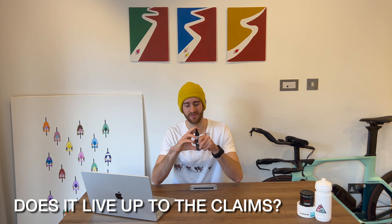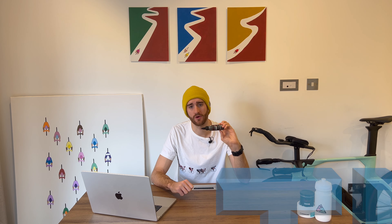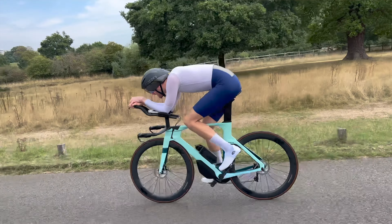With my experience, this chain lube really does live up to its marketing claims, which I think is quite rare for a lubricant. So who is this chain lubricant for? Most people, really. It's a fairly low-maintenance lube with long durations between maintenance intervals and helps your components last longer. I wouldn't recommend it for mountain biking in dry conditions — because it's a wet lubricant it will still pick up lots of dust — or for time trialists trying to squeeze every last watt of efficiency, who might as well go to a wax lubricant. But other than that, it will work for pretty much almost everyone.